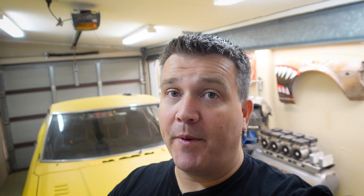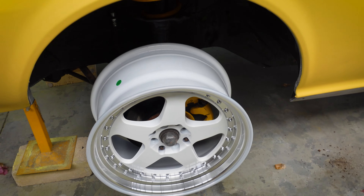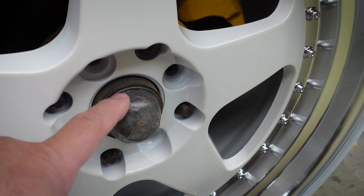Before heading to the tire shop, I couldn't help myself — I threw one rim on the front. Clearance to the strut is zero, and at the hub mounting face there's about a centimeter gap, which means we're definitely running a spacer. Not a surprise. We'll need to add clearance on the strut, so we're probably looking at around 15mm — 10mm plus 5 for wiggle room. I'm also worried about fitting the center cap over the dust caps, so potentially a couple of problems there.